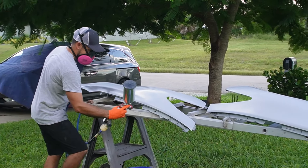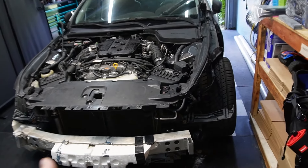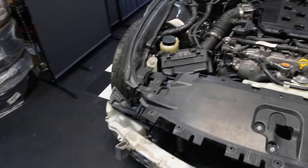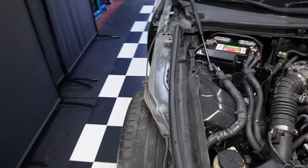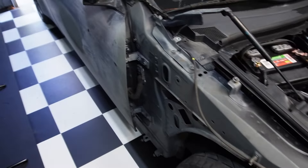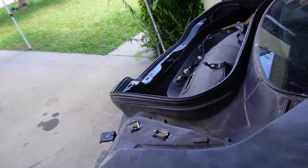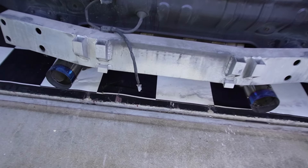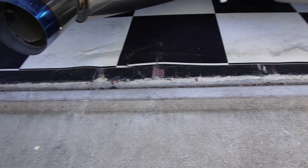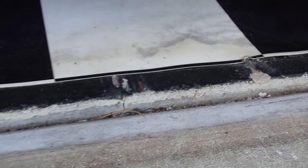The trunk has already been sanded and cleaned, everything scuffed up. The hood is going to start to look the same - once it dries it should look dull, not shiny. Anywhere I see anything shiny I'm going to hit it again, because I want the paint to adhere. I like to do every panel twice - everything gets cleaned twice, rinsed off, then wiped down with grease remover, and then it's ready for primer. I'm almost done.